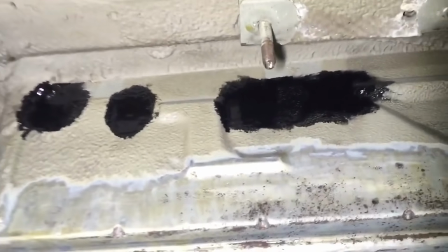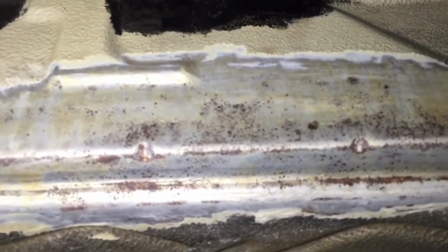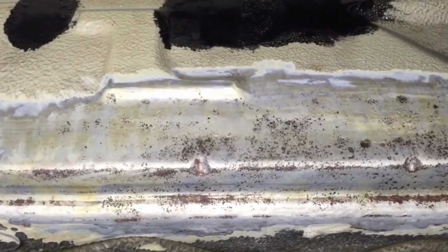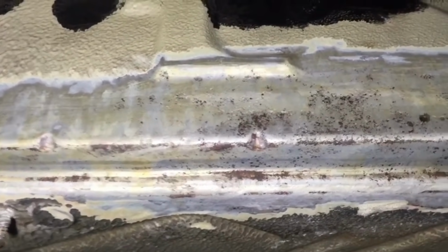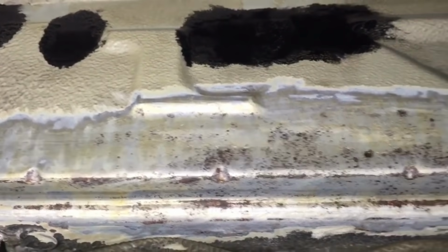And we've done the extra items that we do on most vehicles now. This one still has more work to go. As you see us do, we've got corrosion in there. When you see black pits only, we're okay, it's neutralised, but when there's still an iron colour coming through, we know there's still corrosion in the grain of the metal, so we need to go over that one again.